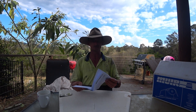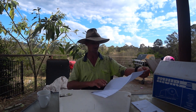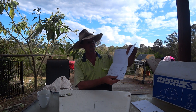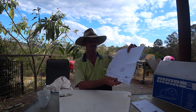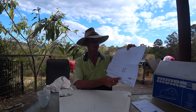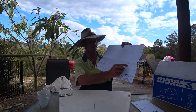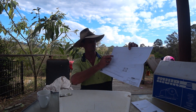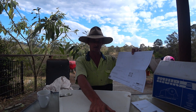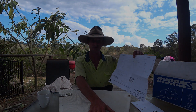So what I'm going to do now — they say photocopy it, but I don't have a scanner that big. So I'm actually going to get a pair of scissors and just cut it all out — cut the outline out all the way around. That way I can literally lay it on top and that's my template, perfect. And we'll soon see whether my pencil marks line up. Now I've got my template cut out. The next step is to drill these holes — it says 10mm holes right here. That's exactly what's going to hold the actual winch down. You also have other holes here that we have to drill — that'll be a 16mm. And I've got to drill four holes in here, and I've actually got to cut that piece out, which I'll cut out with a jigsaw.